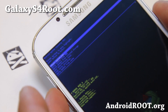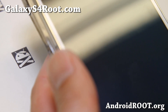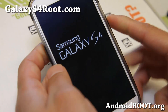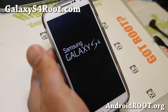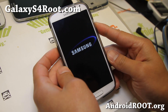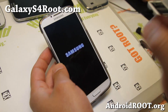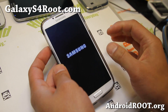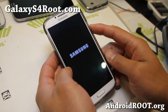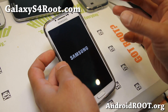That's how you can unroot. Now if you just rooted without custom recovery, you can also use the universal unroot method, but this Odin method is a sure method that will work. You do need Odin for this. You can also use Heimdall, but I don't recommend it as much. If you have a Mac or Linux, I do recommend running VMware and running Odin inside Windows within your Linux or Mac environment.